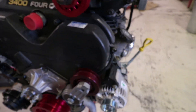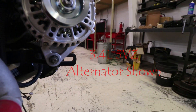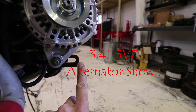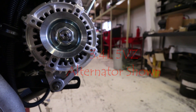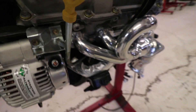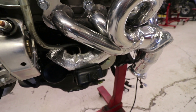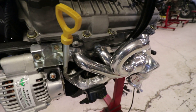Moving towards the front and the other side of the vehicle, on the alternator we do trim the lower bracket — we trim the side off it so the adjuster goes away. That makes more room for the steering shaft in the vehicle that it's going into. It's nice to have the dipstick in place, which does pass through the left-hand engine mount into the engine block.